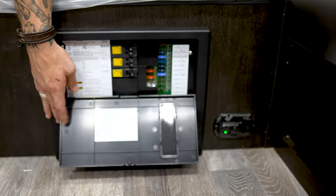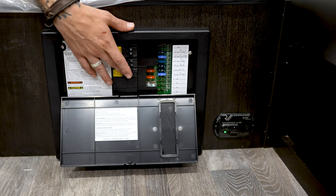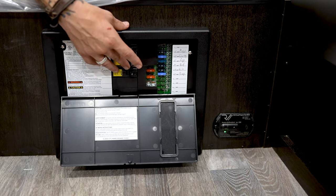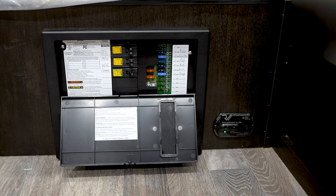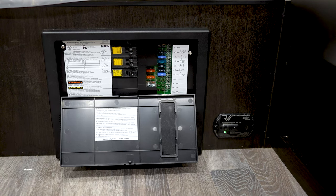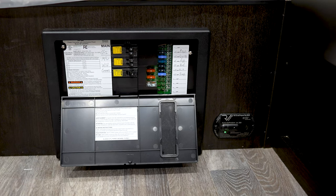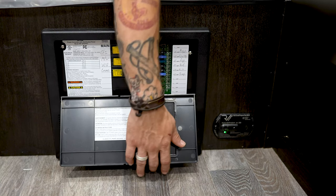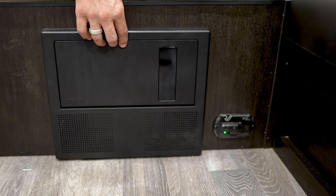Coming over here, this is going to be our fuse panel, breaker box, and converter. On the left side, we have our resettable light-switch-style 110-volt breakers, just like you're going to find at home. On the right side, we have our replaceable automotive blade-style fuses. I recommend that you keep a few spares in these values with the unit — that way, if you're out there and you have one that gives up on you, you do have one to replace it. This is going to give you a little LED indicator to which fuse that you have problems with, and through this little window, you'll be able to see that light so you know just what fuse you need to change.